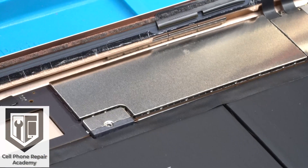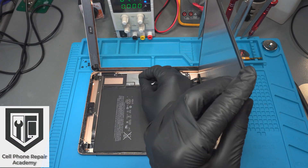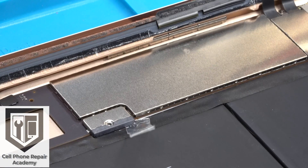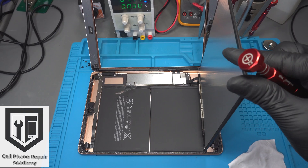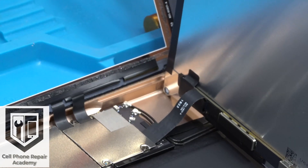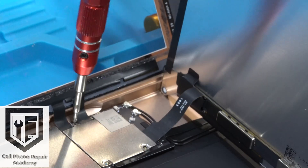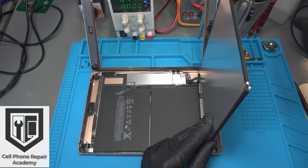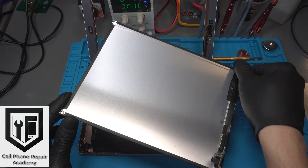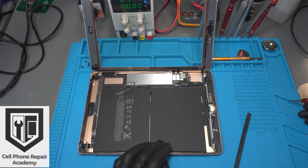Now we will remove the screw on the battery connector — a single screw that uses a Phillips screwdriver. Once removed, insert a small film in between the battery and the motherboard connector to prevent contact. Then we work to release the metal plate that secures the LCD and touchscreen flex cables. This metal plate holds three screws requiring a Phillips screwdriver. Remove the three screws — the metal plate may stay attached to the LCD flex cable, which is totally fine. As a good rule of thumb, put these three screws back into place to keep them organized; just don't tighten them all the way.